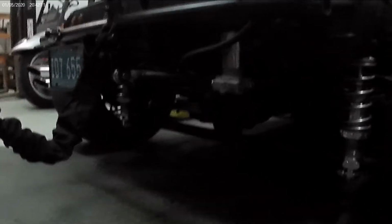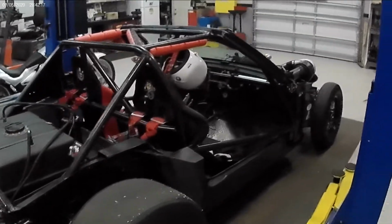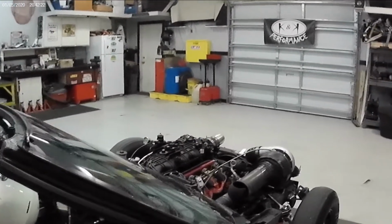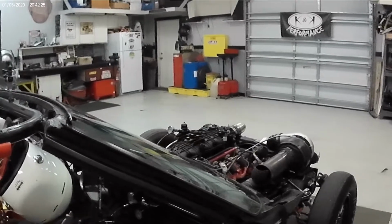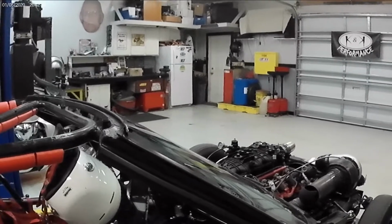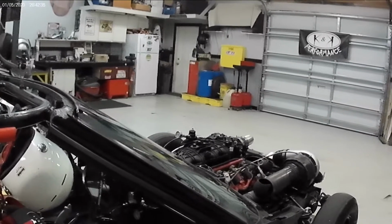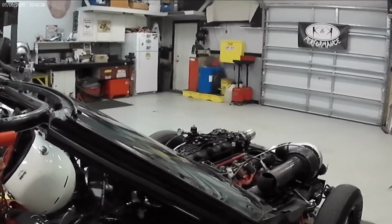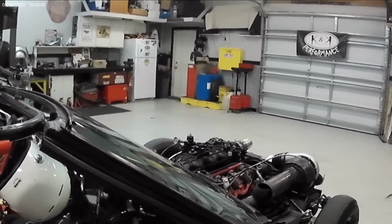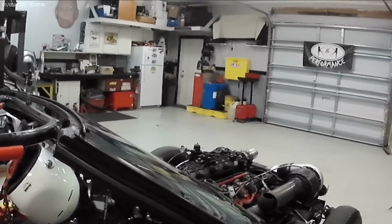Last night was the first time back out in quite some time. We stepped up to a VS Racing Gen 2.5 billet wheel turbo, and switched over to a Trailblazer SS intake and a 92mm throttle body. Basics of the engine: it is a Gen 3 5.3 liter with Summit Pro LS forged pistons, Gen 4 rods and a Summit Stage 2 turbo cam. Very basic, inexpensive stuff to go fast.